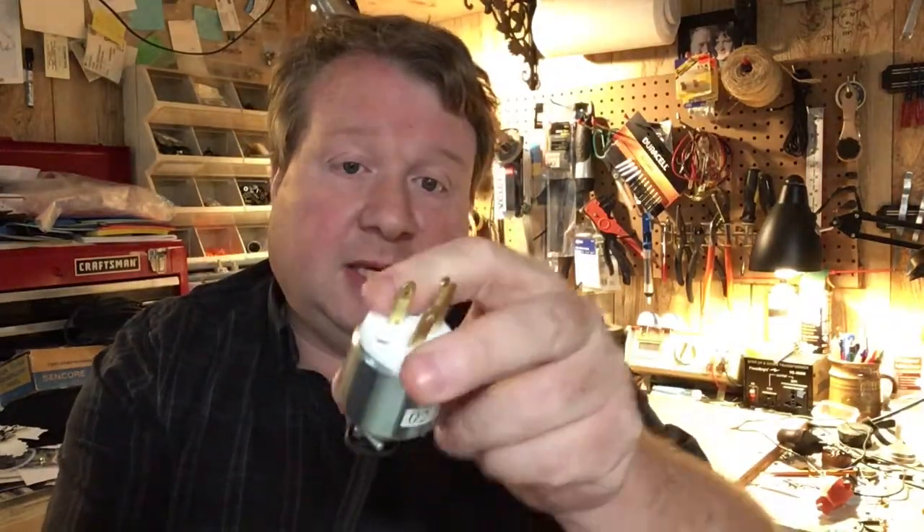So why am I telling you all this? When you get a charger, make sure yours has a hard plastic or neoprene end — not the soft plastic. If you're using an extension cord, use one with hard plastic ends. We're talking about 8 amps, which isn't a lot — you can look at my refrigerator running at 6 amps — but this is 8 amps continuous for 14 hours at a time on level one charging. So you've really got to up your extension cord game. Make sure your receptacle is updated and new. If you're using an old receptacle, you might want to upgrade to something with a really nice, tight connection when you plug it in — not one that's loose or wiggling around. That's enough to cause the same phenomenon we saw with that extension cable. Use only high-quality ends.